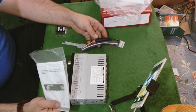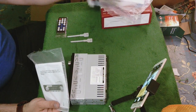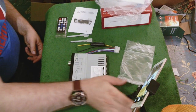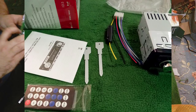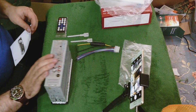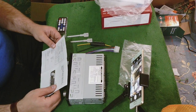The wiring harness adapter does have a fuse in it, which is good — I don't see that on all of them. This is usually the weak point of the stereo: the yellow wire that goes to the battery. I have seen stereos die from just that wire because something happens, there's a short and they just die. So it's really nice to have the fuse link in there. There is no fuse in the back of the stereo, so I guess that replaces it. It's going to be an old-fashioned fuse as opposed to the new knife kind.